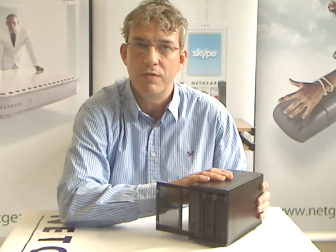I can pull the second 500GB drive out and replace it with a 1TB disc, and the data will be written back across the other way. So then I've just upgraded my capacity from 500GB to 1TB with zero downtime — I could even be streaming a movie while it happens.